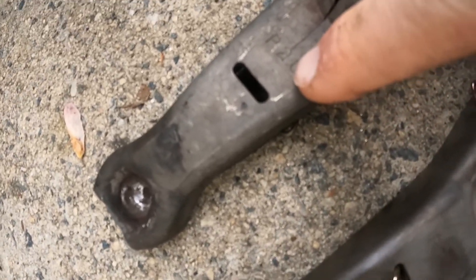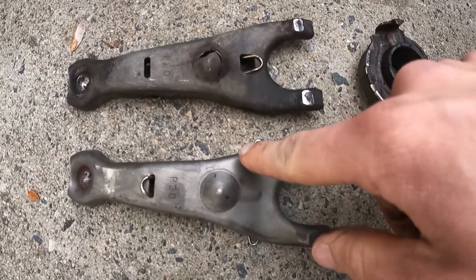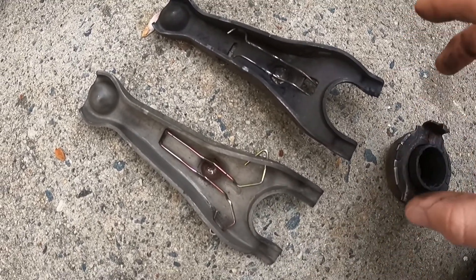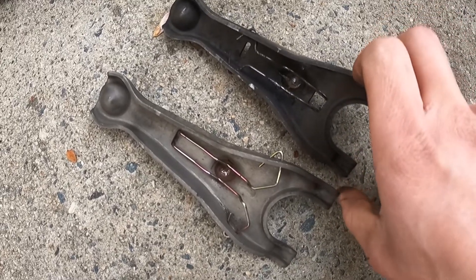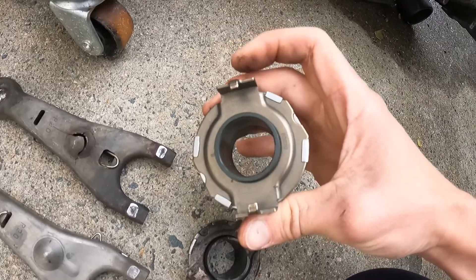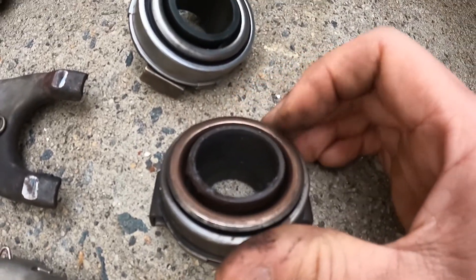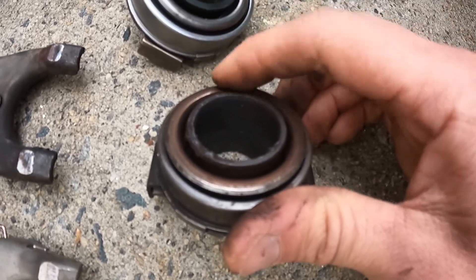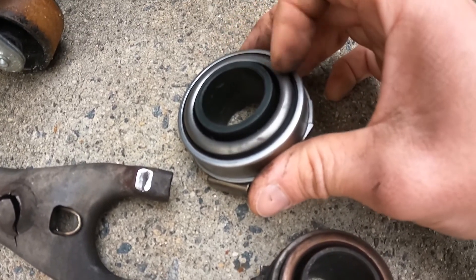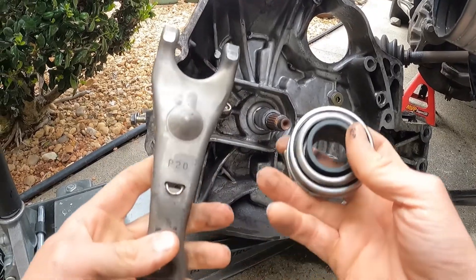As you can see, the old clutch fork and the new clutch fork are basically the same — they both say P20 on them. This one is a little different in the way the mounting bracket sits and the way it's designed; it looks like it's just kind of flipped backwards. Overall they're identical besides that difference. This is the new throw-out bearing and this is the old one. If you spin them you can feel a little resistance on the old one, but this new one feels a lot smoother.